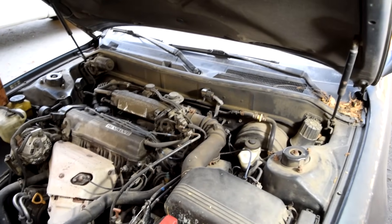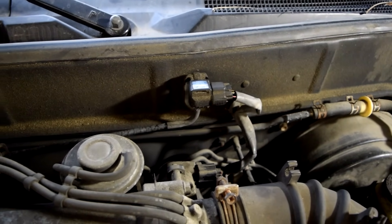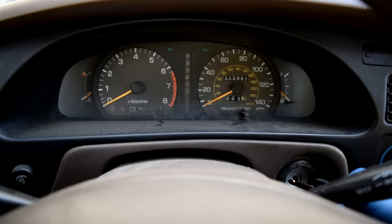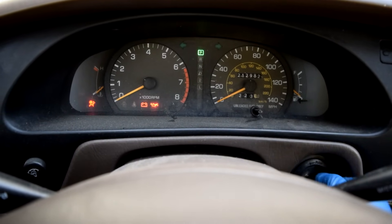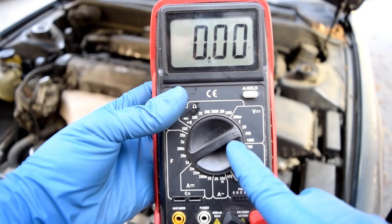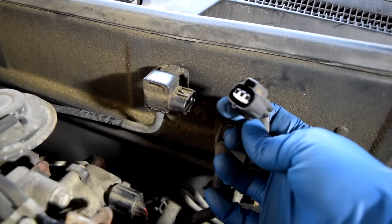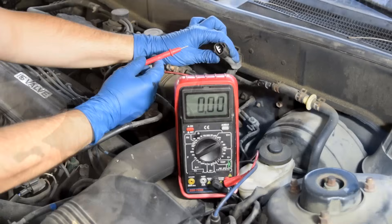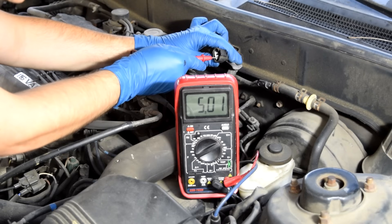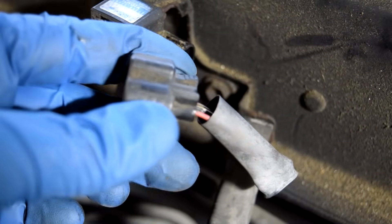Now as far as how you can test these sensors, we'll start with the MAP sensor. First, make absolutely sure there are no cuts in the vacuum line connecting your MAP sensor to your intake manifold. Next, get in your car, put the key in the ignition, and put it in the on position without turning the engine on. Grab your multimeter, turn it on, and choose 20 volts on the DC voltage scale. Ground your black test lead, then remove the connector going to your MAP sensor, and start probing the pins — the one that gives you any voltage is going to be your constant. In our case, the first pin gives us 5 volts, so we'll put that down as our constant voltage supply wire.